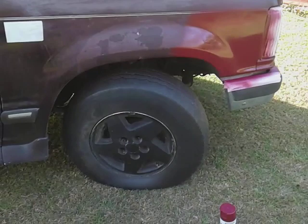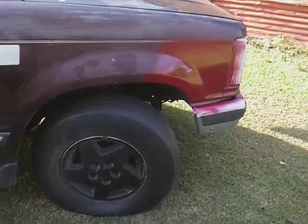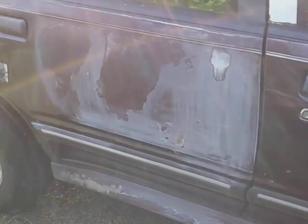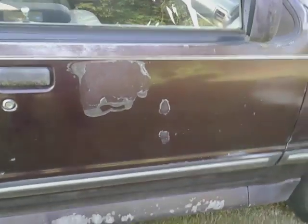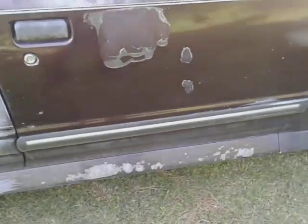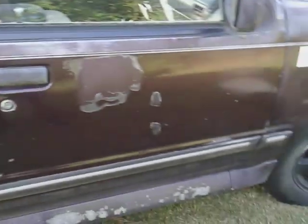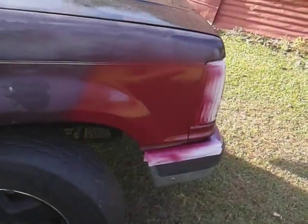Running with black wheels — I don't know how that loudness is gonna look. As you can see from my first video where I sanded the doors and stuff, this side really has to be sanded really good because this side has clear coat on it, so all that clear has to come off. It's gonna take a good two to three hours to really sand this side down real good. Might have to cut it with some 80 grit or 3M 60 grit to cut everything off so I can get it smooth.